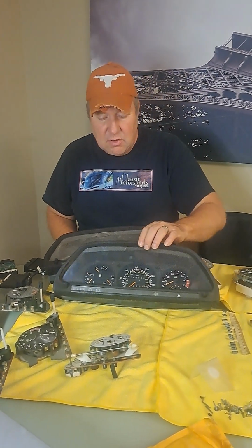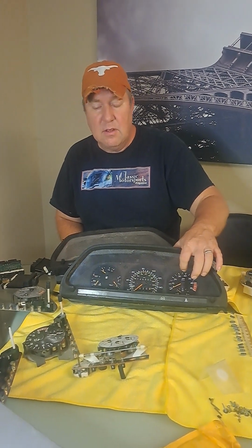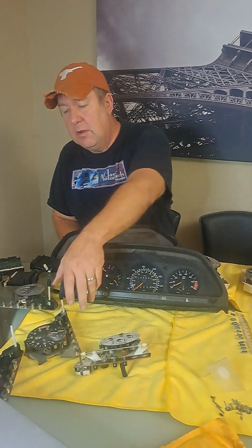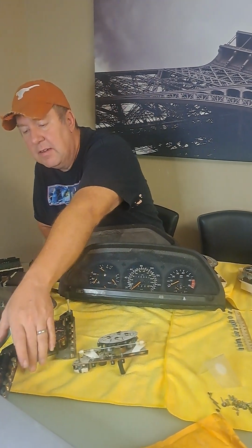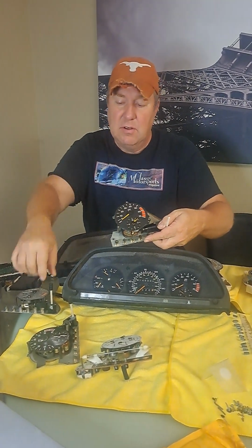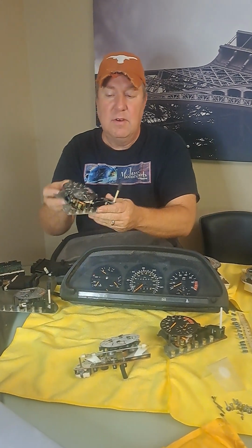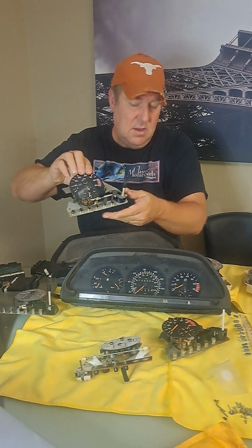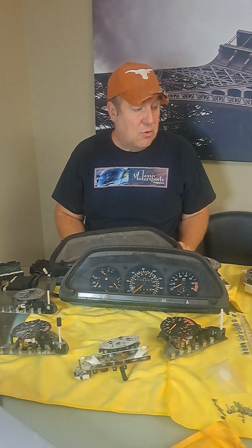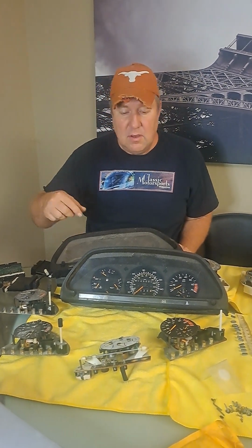With that, a lot of these are going to have all different RPM red lines depending on what you're running. The diesels actually have a lower rev limiter, but to give you some idea, a USA 500 is going to have a 5500 red line start. A Euro 500 would have a 6000 red line. Some of the 380s you're going to see with a 6300 red line. It just depends on what the car is.